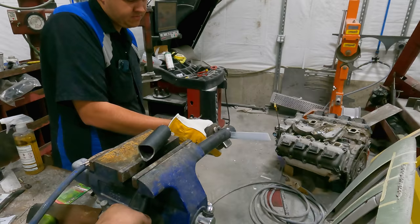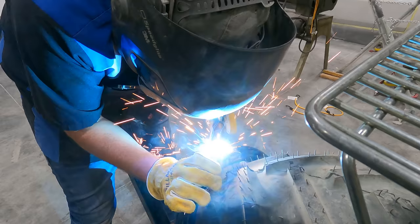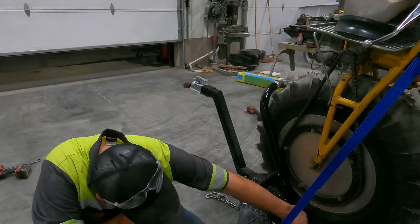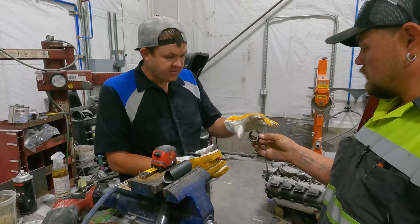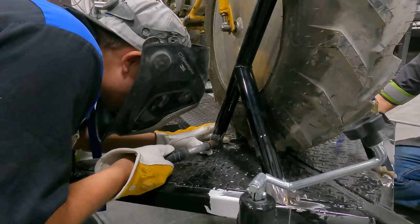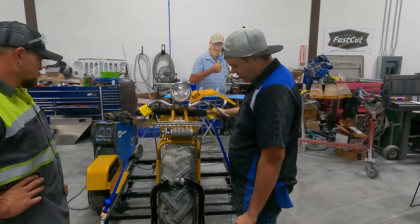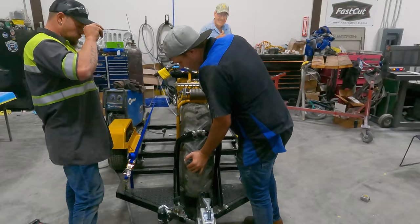Let's go fit that in and see if it's going to work. We need to cut two little feet pieces for the bottoms - they're five-eighths of an inch. Test fit it on the other side. I'm pretty glad that I went down to Matt's and got us some metal - seems like it's just going to work out perfect. We'll get these things deburred and get them all welded in. We got the hoop all extended, got it half welded - welded enough that we can tighten the bike up in it. It's holding tight, it's got room for the sprocket, and I think it's going to work out just fine.